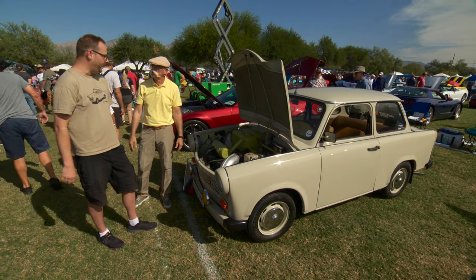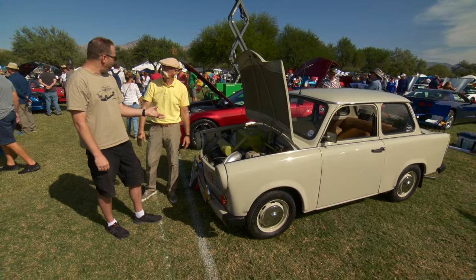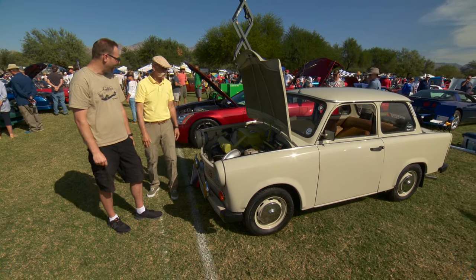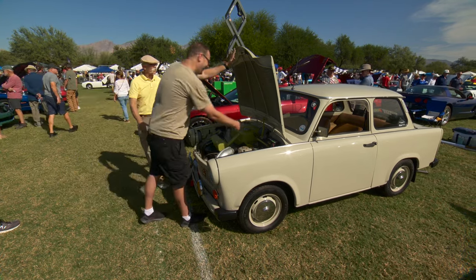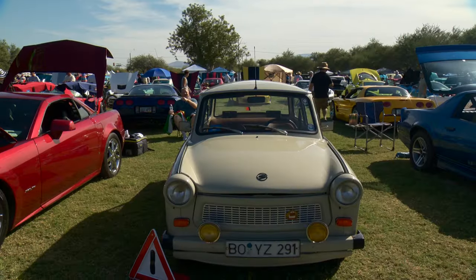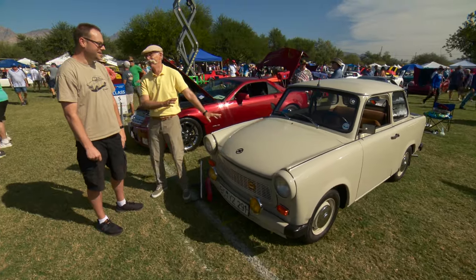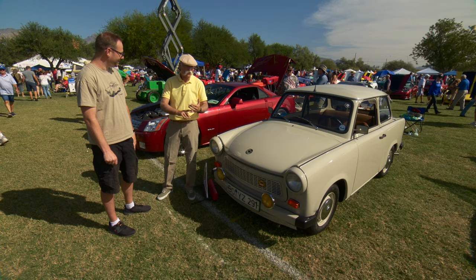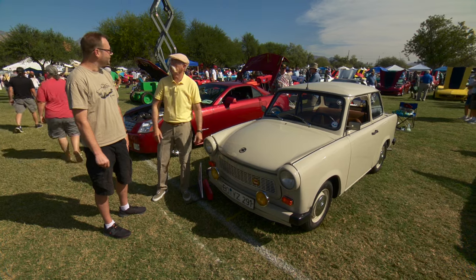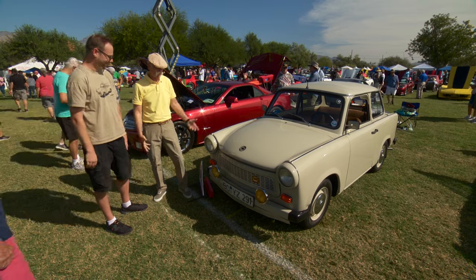It's a two-cycle so I have to mix oil - I bring a little container with me. Over in East Germany they didn't have that problem; they could get pre-mixed right from the pump - 40 or 50 to one. Being a later car, this one wants 45 to one. When I saw it I was like, I've got to meet this cat. The most amazing thing is that it's a 1987, because it sure doesn't look it. This is what they call a 601S. Alan, awesome - thank you. Trabant, I love it!